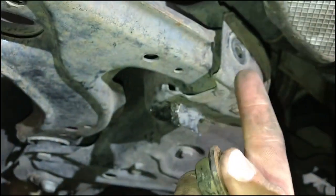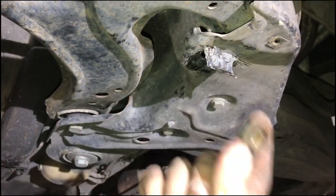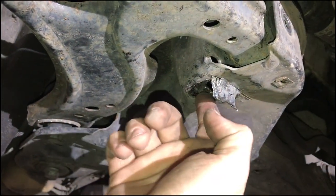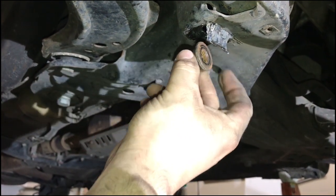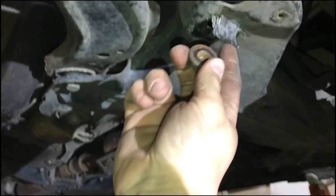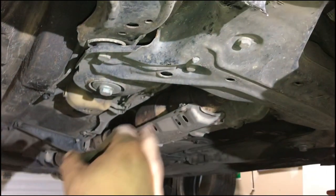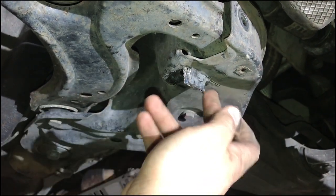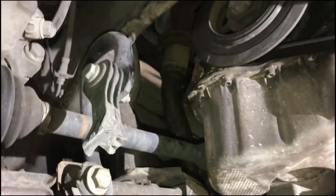So to get this out, because the bolt is now spinning, you have to cut a slit in the subframe, bend it down, and hold the nut with locking pliers. I managed to hold it that way and use an 18mm to undo it and pop it out. What I'll do is sand it down to bare metal, have my buddy come and weld it at least halfway — whatever he can get from under there. Or I'll put a regular nut on, tighten it, and when I get exhaust work done, have them tack that nut as well, beat it back in, and weld it all around. So all safe and sound — but yeah, how stupid. That's what I had to do to get this out.